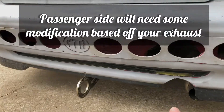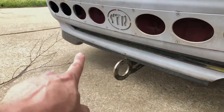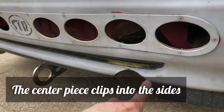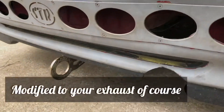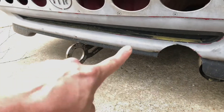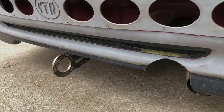With the center piece, you line it up and connect it to the driver's side. It'll actually overhang — it's too long for the back — so you're gonna have to cut it just like every other piece. Once you've made your cut, you can drill new holes along the top and install it, or if you're lucky enough, you can find a hole that already exists.